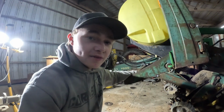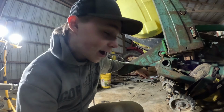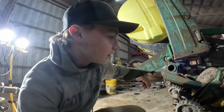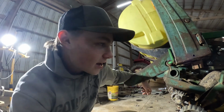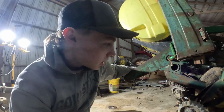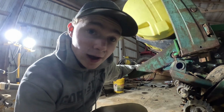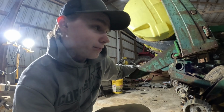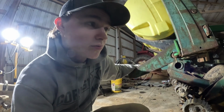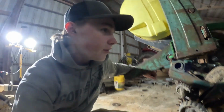The next one was the same way. Then we got to the one that I'm down there now, and they're just flat out snapping as they're going in. And I'm done with it, because we're gonna have to weld nuts on there and get them out, and it's too much of a pain to sit there and keep snapping bolts and trying to fight them to get them out, when we just need to wait and put new bolts in, because you're gonna dig yourself in a hole. So anyways, moving on, we got more stuff to do.